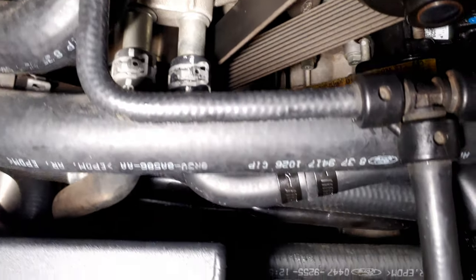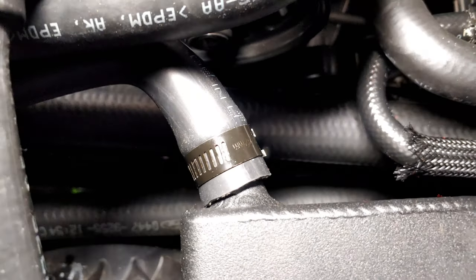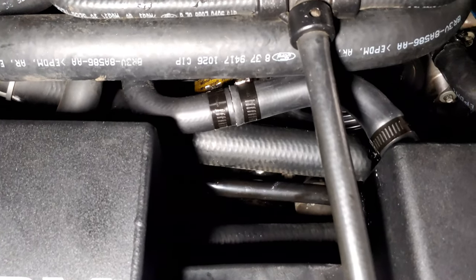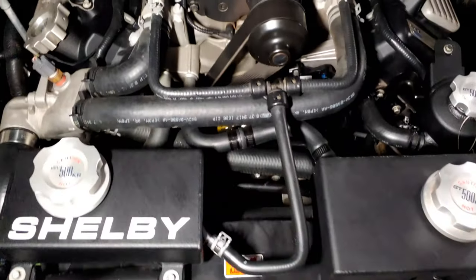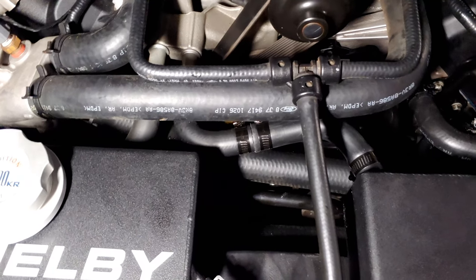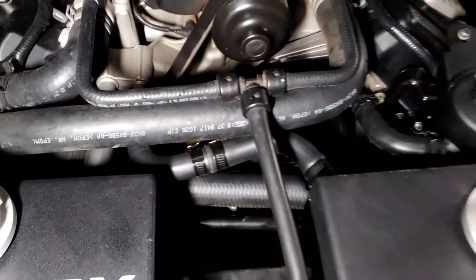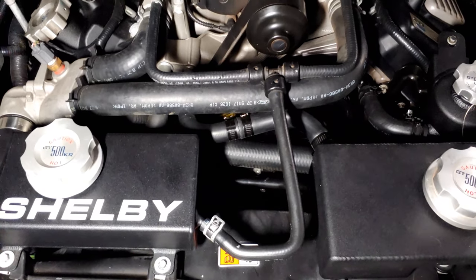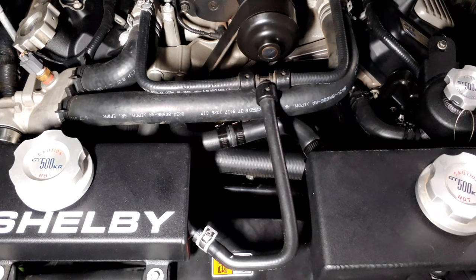Back at the car, all buttoned up, got my connectors back on — and there we go. We've got the extra hose needed. It's also nice because this reservoir was kind of being tugged on because that hose was too short. Now it looks great, and even from up here the black clamps blend right in. In my situation I could have used the OEM hose and made a shortcut on it, but because of its rarity I decided to keep it with the original parts. This solution worked out just fine. Hope this helps you if you get into a bind with a coolant or radiator hose that you have to manufacture. Until next time, this is the Eclectic Candyman — we'll see you later.